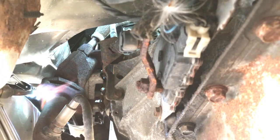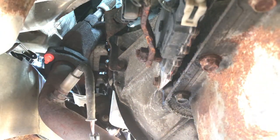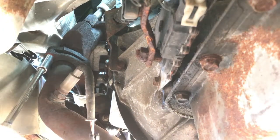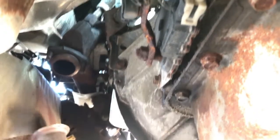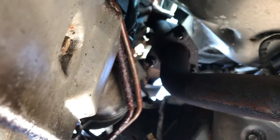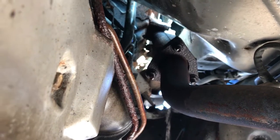Get a second bolt cherry red — that's what it's going to take to get them off. She looks plenty red, so get her off there before she starts cooling down too much. She's loose. This pipe with the crossover is a catalytic converter and it wants to come out going towards the back of the vehicle. You want to heat them up — don't put an impact wrench on them. Heat them up good and they'll come off for you.